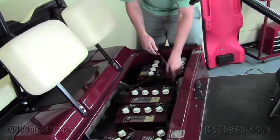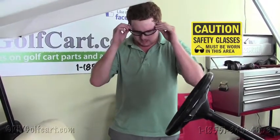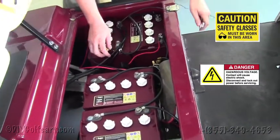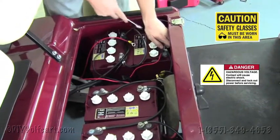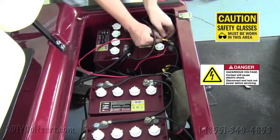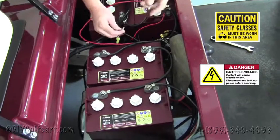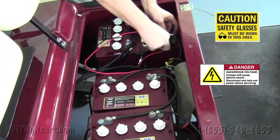Once we've got them poked through, we'll want a zip tie at the bottom just to hold the wire securely in place. We'll be working in the battery area of this Club Car DS, so this requires the use of some safety goggles. Now that we have our positive and negative lead already equipped with the correct terminals, we'll grab a 9/16 wrench and locate where we installed the voltage reducer — right here on this positive post — which took the 16 volts combined in these two batteries and reduced it down to 12 volts. We'll install the positive there, then plug the negative terminal spade in and tighten down the 9/16 nut.